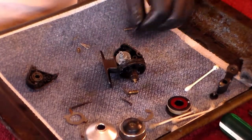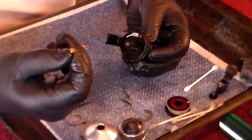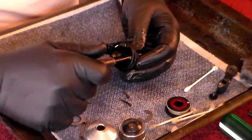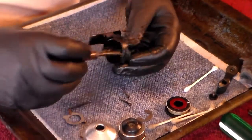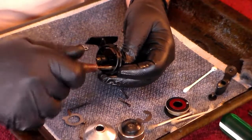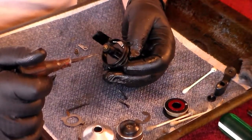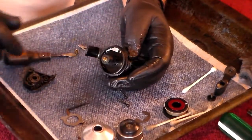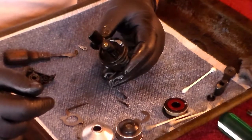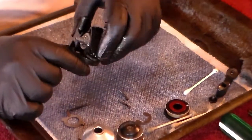Next, let's go ahead and put our drag knob back in. Put it in and the screw goes back in, screwing into the knob. Screw it until the head is all the way down flush. From past experience, if you ever come up on one of these and it's really tight, don't try to force it — give it lots of lubrication first. I have snapped those screws off; they're brass and very easy to snap. So if it doesn't want to turn, use your penetrating oil to get it in there and hopefully it will break free.